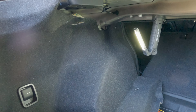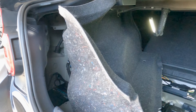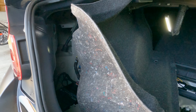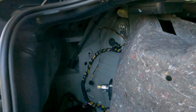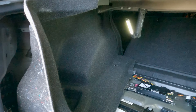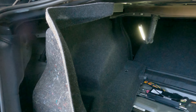In the M2, it isn't bad to pull the whole carpet — it's not hard. These shapes aren't overly complex and hard to get back in. There are some models, like some of the X3s, where pulling this carpet is really difficult, so it's going to depend on what you want to do. In my case, I'm going to pull the whole thing once I pull that plastic rivet up at the lead. But you can also peel the entire back edge away and get to almost all of the bare metal on the inside. So if you're really struggling, just peel it back and secure it so you can work to put down the sound skins.